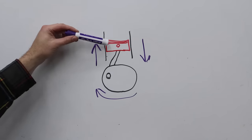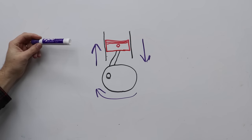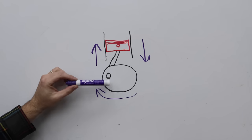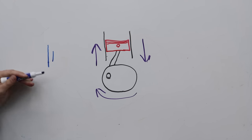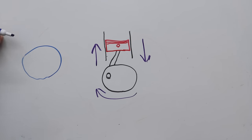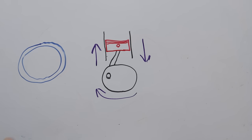Let's look a little bit deeper into some of those parts over at the board. When you hear of an engine size, you're talking about two numbers: the bore and the stroke. The stroke has to do with the crankshaft and how far up and down the piston moves — increase that, you increase the overall volume because you'd have more distance traveled, pulling in more air and fuel. The other number is the actual size of the piston itself. A bigger piston is more volume, more bangety-boom-booms — more power. But it's not just that simple. As you go larger with your piston, there's more chance of what's called piston slap. If the piston is too large, it will start to wobble around in there and cause increased wear.